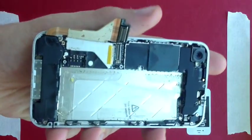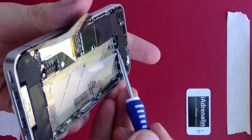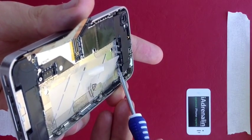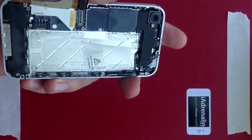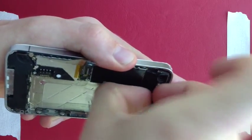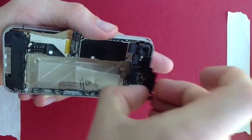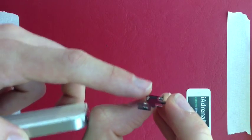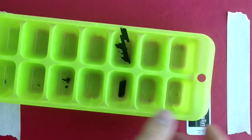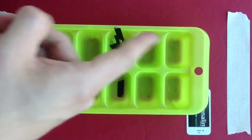Now remove this little cap. It gets a bit stuck because there's a small C-shaped clip just here and here that comes around and tucks underneath that piece of metal on both sides. What I do is put my fingers under each end of it, give it a bit of a jiggle, push down and around — down and around — because of that C-style clip underneath. When reassembling, the second screw is the main screw and just enter clockwise.